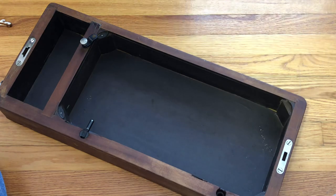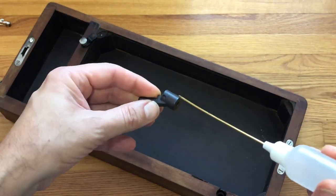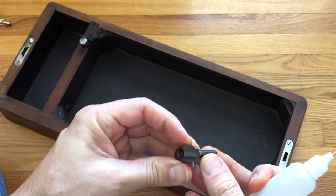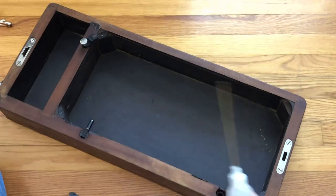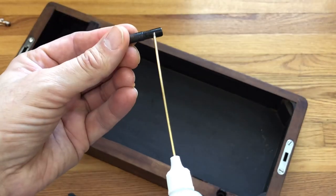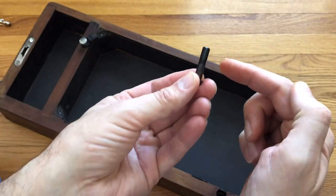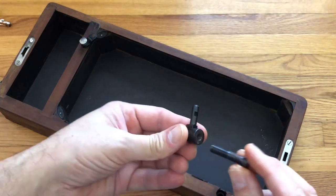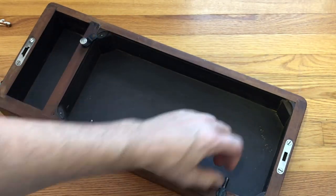I'm going to take the other hinge. You guys might think I'm being overly anal, but I respect these vintage machines so much because of how they were made — why not oil the hinge? Who knows if it'll ever come out of here again. Now the bolt — remember this is true not only of these but any bolt or screw on a vintage machine: once you've got it cleaned and any corrosion is off, put a drop or two of oil at the very base of the threads. As you screw it in that oil will spread. I didn't really have a problem with the threads even with the surface rust, but now I feel a little bit better.